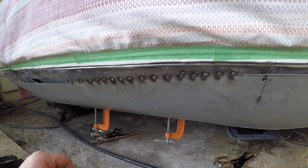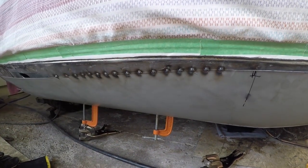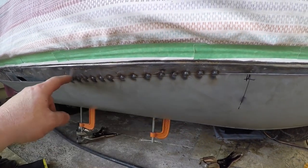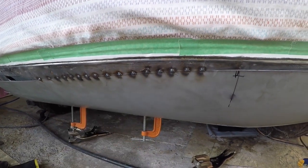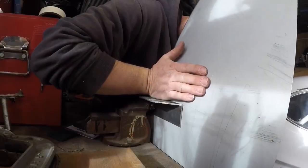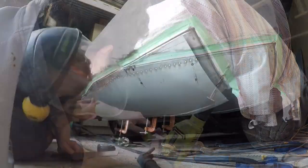His technique is to lay your new repair piece over the existing panels, which I could do in this case — I still had a lot of my valance left and also had the point at the very bottom for the crossmember as a reference. So you overlay it, press it down flat, and tack weld the edges to really get that panel into position. I also had to hand form a little V on there because the Capri has a bit of that shape in the nose cone.